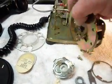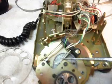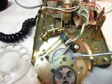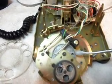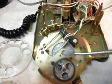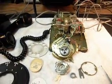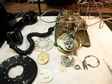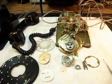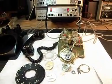The nylon plastic stop goes on the other side of the rotary, right in this area. It lays right in here and hits your finger connections — your contacts — and it also stops the gear. The other tab does the same. Once it gets pressed backwards in the wrong direction, it snaps everything and breaks it. It doesn't always go like you want when you take those finger wheels off, and it can ruin things. This is just a repair gone bad, but we'll get it all squared away and back into working condition for Lewis. This is Dennis with A1 Telephone — thank you for watching and have a great day.